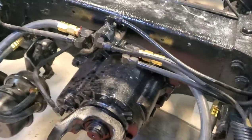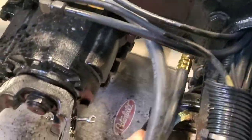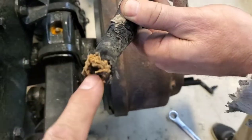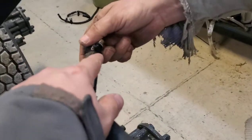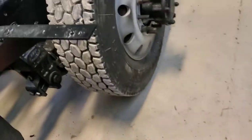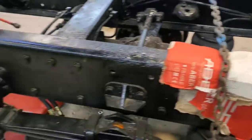So we've got the lead axle on the back done with these. We're going to replace a lot of the plastic lines as well but we just don't have the stuff today, so today we're just working on the bigger rubber airlines — the ones that flex when the axle goes up and down. This is the shape they were in; these actually just twisted off when we put a little pressure trying to get the fittings out, and some won't even come out — they're seized right in there. Good thing we're doing this because that would have left us in a tight spot on the road.